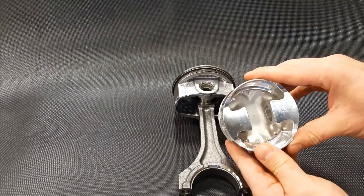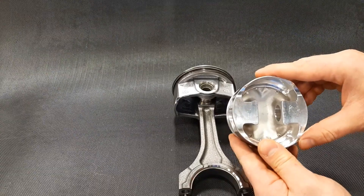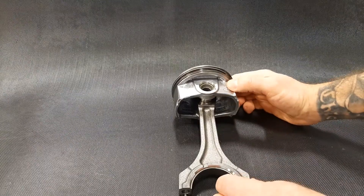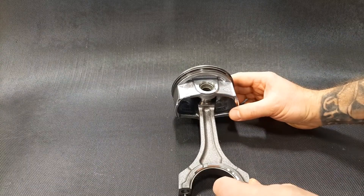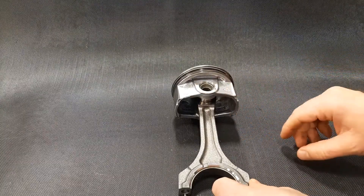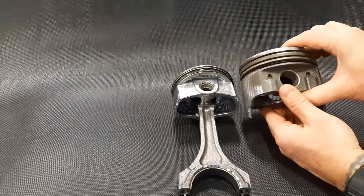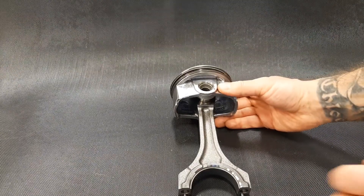This piston was basically pounded into shape and you can see how smooth it is — the tooling marks there definitely indicate that manufacturing process. Hyper eutectic means that this piston has got a high silicon content, which is really good for thermal properties and also good for strength. You can tell the silicon content based on the color of the alloy. If I show you a traditional cast aluminum piston you can see they don't have quite the same luster to them.